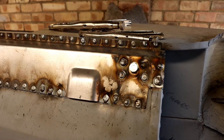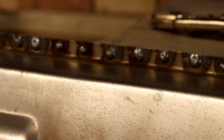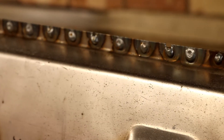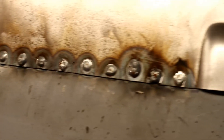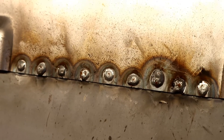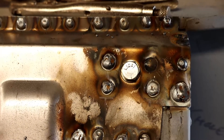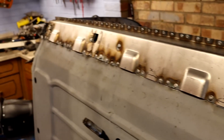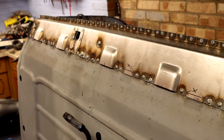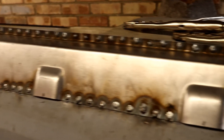I'm happy with that — the sill is now welded into place. The welds that go along the top went really, really well. The ones at the bottom not as well, mainly because there was zinc spray on the underside of the sill which caused a bit of splattering, but they went in the end — you just have to let the zinc burn off first. Around where the special brackets were they went okay, and actually it's looking really good. I can now clean back some of these welds, get some zinc primer on the top, and that will be this side done. Hooray!